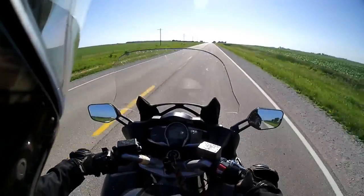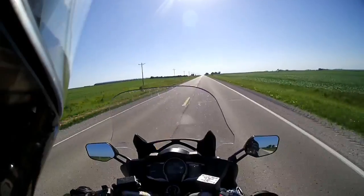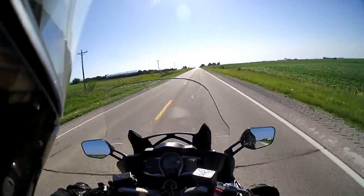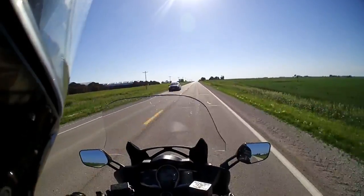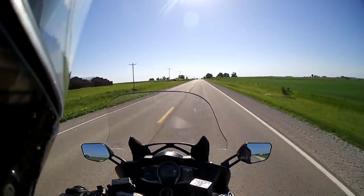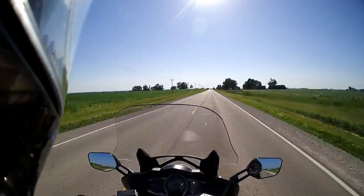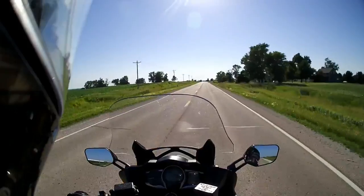And a fuel gauge. Fuel tank capacity of this bike is approximately 6.5 gallons. The fuel gauge will actually tell you that you're basically empty and switch to reserve when you still have about 1.5 gallons of fuel. I don't make a habit of running it that low because it's unnecessary, unless I'm on a long trip and I'm really trying to make time, and then I may push it a little bit further. But I don't want to burn up my fuel pump, and what's the point?